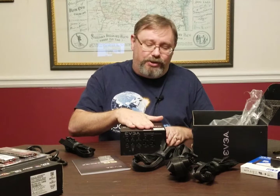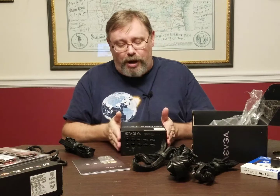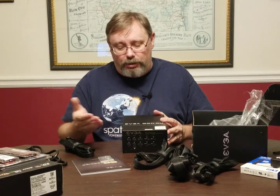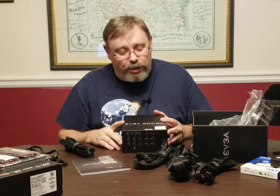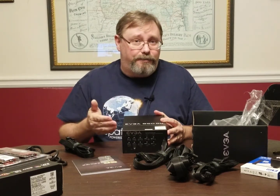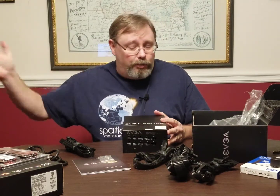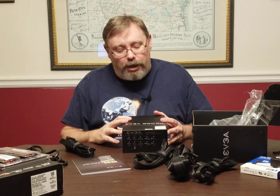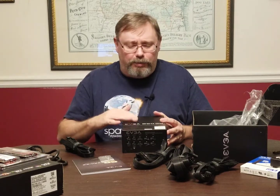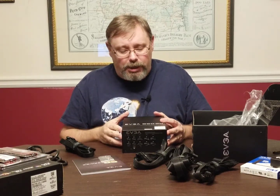So as you're going to build a system, this is the heart of it. I mean, this is what's providing power. So if you're building one from scratch, you'd want to make sure you don't skimp on your power supply. Get one that is sufficient in the amount of power you need, as well as one that's high enough quality. Make sure it is 80+ certified. Whether it's just 80+ certified or bronze or silver, gold, whatever, is not as important, but do make sure it's 80+ certified. That way it's built with some good quality components, and it has been reviewed and certified by a body, having met some sort of standard in that regard.